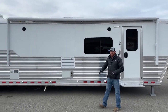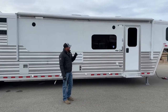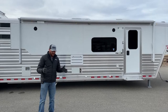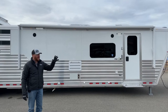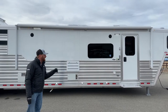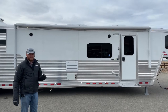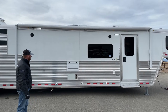The aluminum cover is fantastic. We're big advocates of that. The reason why is a lot of older trailers will come in possibly on trade and we'll say, hey, can you just roll out about the first couple feet of that awning? Because that'll tell us everything. A lot of times the UV rays will just eat those awnings alive. They get really frail and brittle, and they'll just break up over time. We can actually see through the awning from the bottom side, but having that aluminum protective piece on there is really going to give that awning a lot of longevity and help it hold up over time.